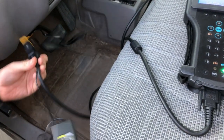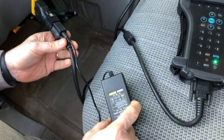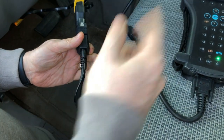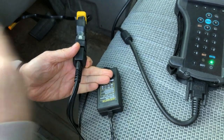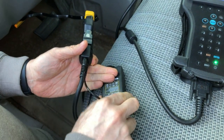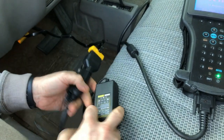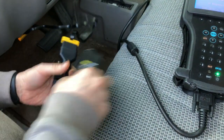This here, I've got the AC adapter that came with the TEC-2. This could just as easily be the battery adapter — you get an adapter when you buy these that plugs in here and also hooks up to your battery. Either one of those will work in combination with this cable so that you can cut out the power from the DLC, and it'll be immune to this problem.